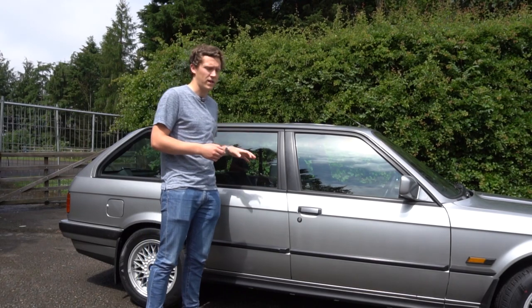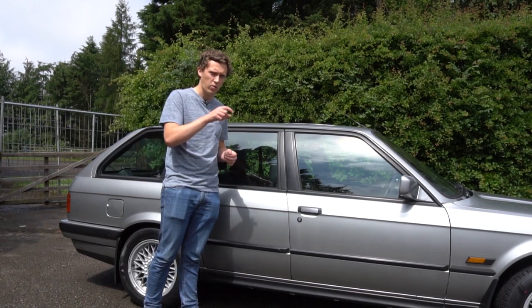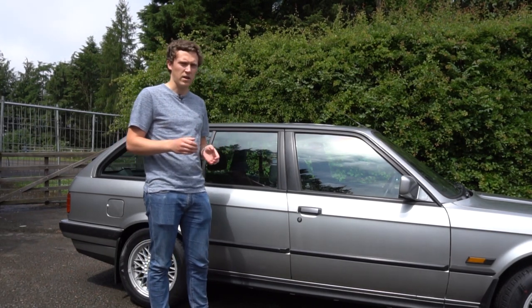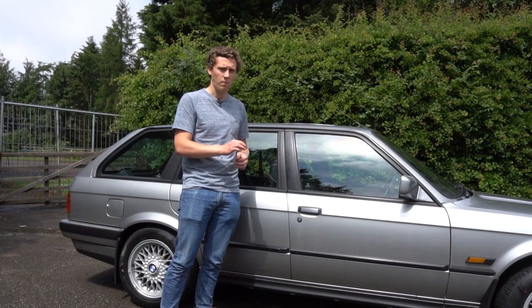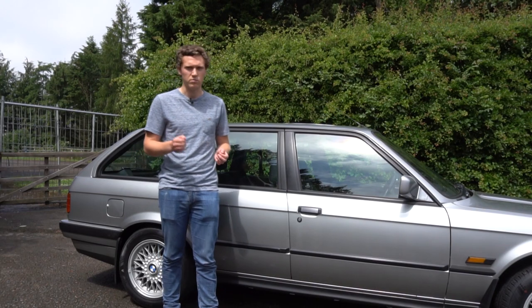On mine I've just recently fixed the rust on the sunroof and it was pretty badly rusted on the underside. I had to cut out quite a bit of metal, weld in some new stuff, and I used a fiberglass filler in a couple of the smaller holes as well, then got the thing re-sprayed, and that has fixed it for should be a number of years.